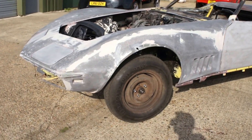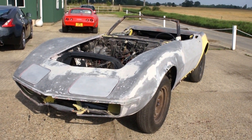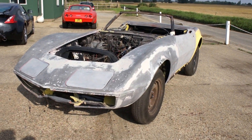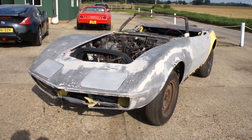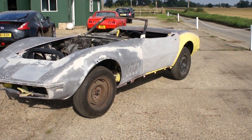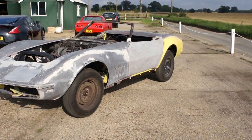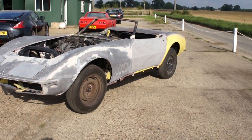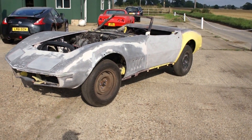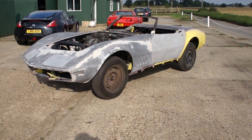It's Tuesday today, we've just come back after the bank holiday, and Alan is back on Thursday. So we're going to make the fender and make the rear light panel, and then I guess it will be towards the end of next week when we start getting those bits. I might cut those panels off in readiness for him — yeah, I think I will. Once we've got them marked out, I'll come out with a grinder and get those panels off so we're ready to just start trial fitting.